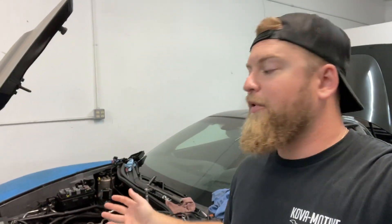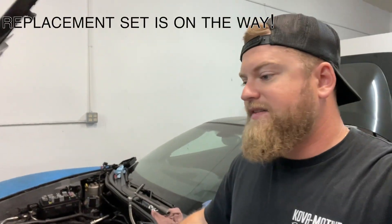At this point I don't know if these lifters are defective or what's going on. The company that I spoke with were just as confused as I am. The guy basically insisted I didn't have to take it apart and these should find their sweet spot, which of course they didn't. Either way, these lifters are not going back in this car. The one I pulled apart is damaged, and I don't know what the other 15 look like. So even if I have to buy a new set, so be it. These are not going back in. I'm in communication with the company seeing what they can do to get this sorted out.